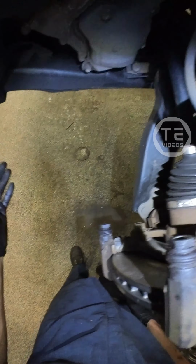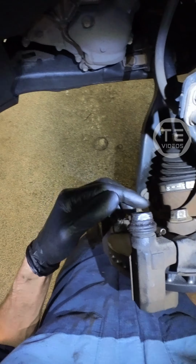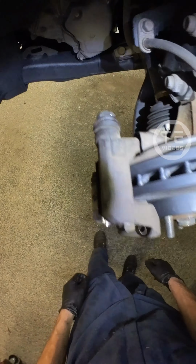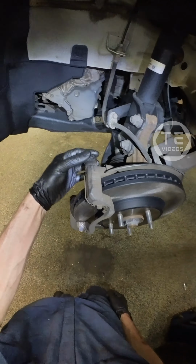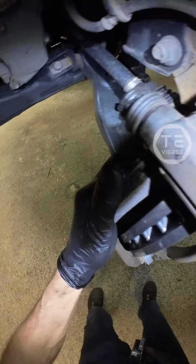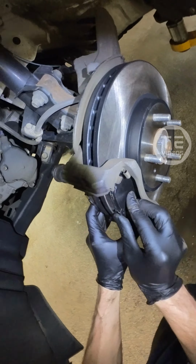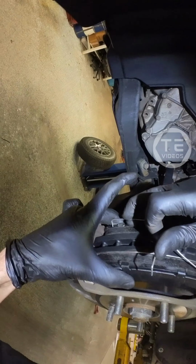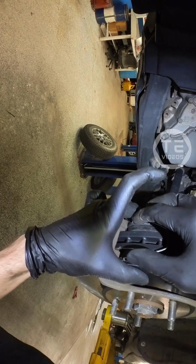Need brake pads, new shiny rotors, lubricated slide pins, and there's definitely some mystery grease in there because these boots are all swollen, and regular Silglide grease does not make these boots swell up, so whatever. Anyways, throw these guys on just like that right there. Some retainers for you, bud. In you go.